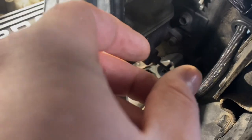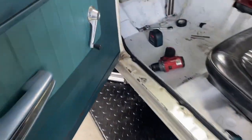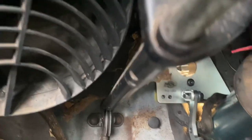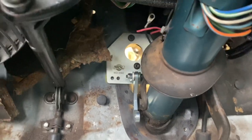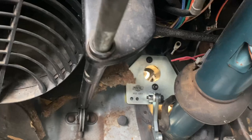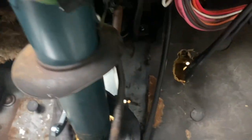You need a helper for this next part. Have your helper hold this, then go inside the vehicle and install the plate. With the plate installed, you can come back and see where you need to drill your holes. It's tight in here, but hopefully you'll have enough space. Read the instructions for which holes to use since it depends on your make and model, but you'll drill two quarter-inch holes — not 5/16ths, quarter inch.